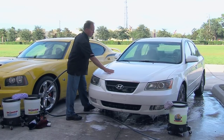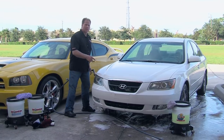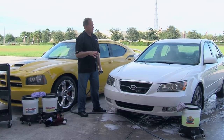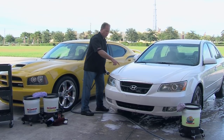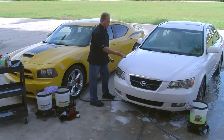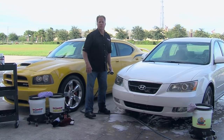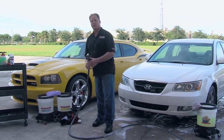That's what I call the aggressive method of washing the car. The paint is just as slippery and smooth as it can be because I've chemically decontaminated it and mechanically decontaminated it all during the wash step. This is exactly how you want to treat a neglected car before taking it into the garage for any polishing work — you want to make sure any abrasive particle is off the car, because when machine polishing, the buffing pad can create an air current that pulls particles from cracks and crevices under the pad. So use the aggressive method, wash it really well, and then it's ready for compounding, polishing, and waxing.